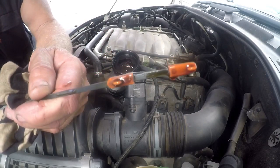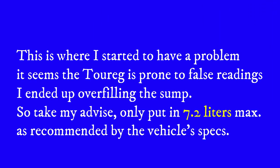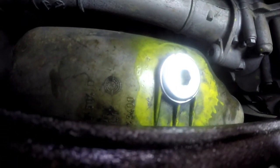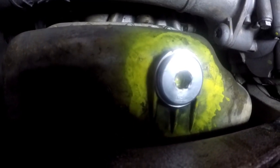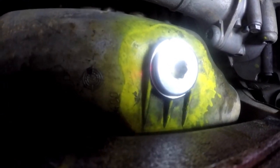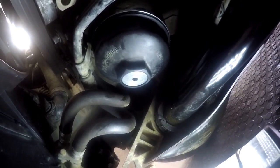We've got seven and a half litres in there — I'll put in another half litre, that should bring it up to eight litres. Checking for leaks on the V8 — engine is running, eight litres of oil in. The sump is nice and dry, no leaks, no drips. Coming to the front to check the oil filter unit — everything seems to be nice and dry, no drips, no leaks.